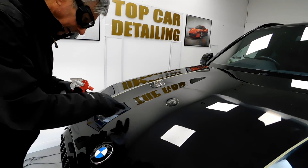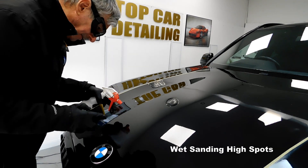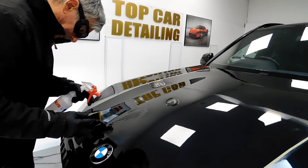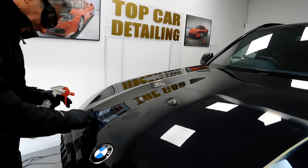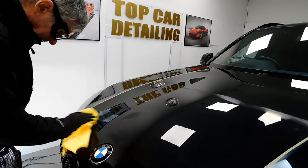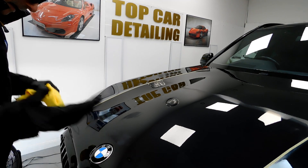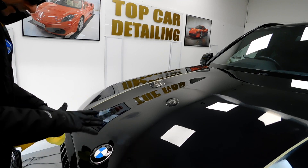We've got some high spots here on the bonnet and we need to sort this out, so just doing a bit of wet sanding here to flatten that off. Just flatten this off here, and then I'm going to polish that now and get that back to clear gloss paint - get the lacquer looking something like, getting rid of these marks now.